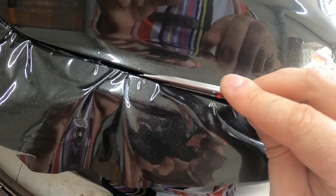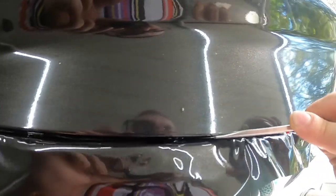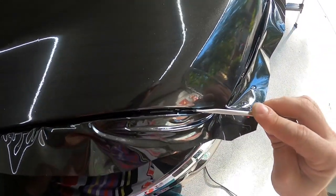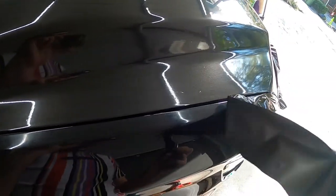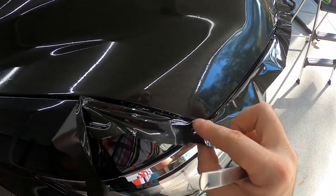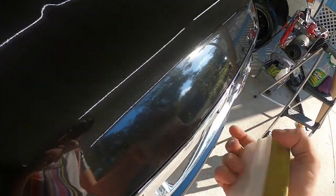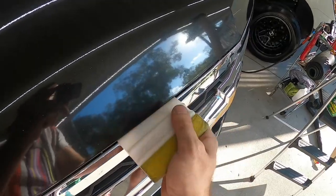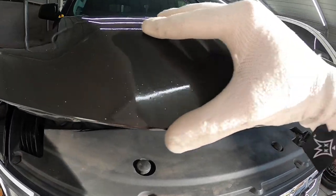Go ahead and start to make your cut in the gap. Be careful not to nick any of the original paint — just be nice and smooth. As long as there are no wrinkles, run it smooth and straight and you shouldn't have any issues. I split it and now I can begin to peel it back, working it towards the corner. With less tension I can lift it up and tuck it down around the edge with no wrinkles. Then pop the hood to get much nicer access to finish up the tuck. Heat it up a little bit, use your finger, get it all nice and down. Same thing on the side — heat the corner and as long as you don't have a bunch of excess, you'll be able to get it right up in the edge.